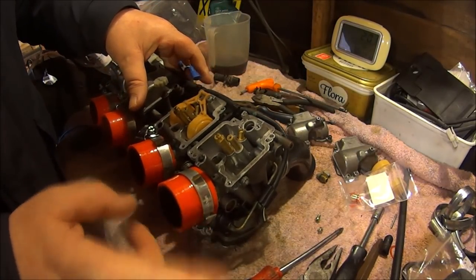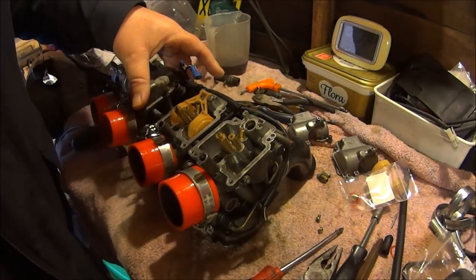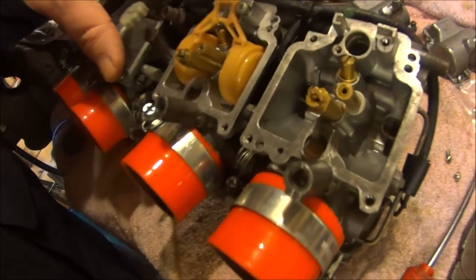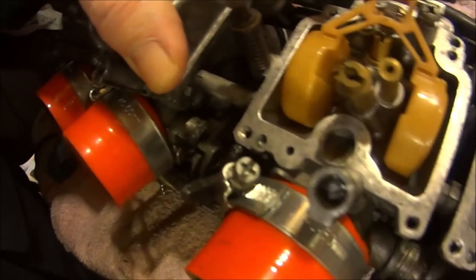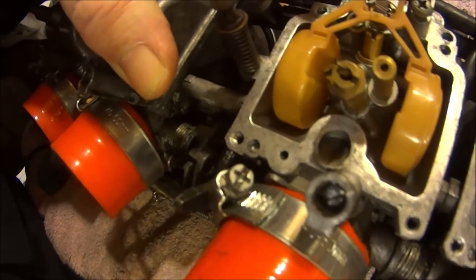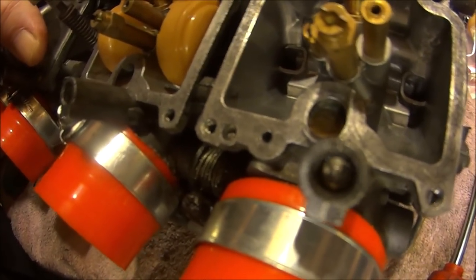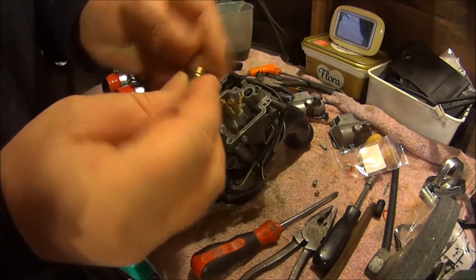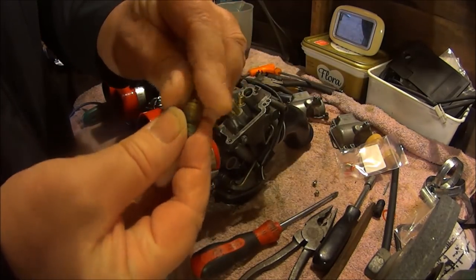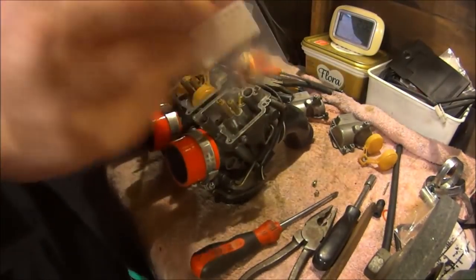So I don't know if it is this and not that. I'm in deep trouble. If I can show you inside, it should look like that with the slot for the screwdriver, but that one, the slot is just non-existent. So please make my assumption be right. Just be the float needle valve and I will be a happy man. Anyway, enough said. Let's get it in.